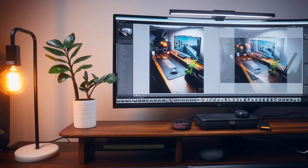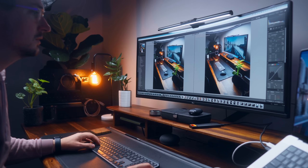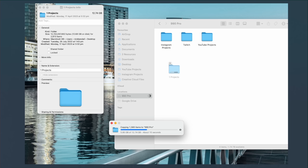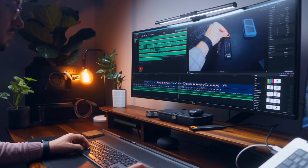Will you really notice a big difference jumping from an SSD to an NVMe drive? It really comes down to what you're using it for. If you're transferring huge files frequently to and from a fast internal drive, an NVMe enclosure will save you a lot of time. For editing, I've moved all my projects to this drive and it does feel a little faster. On my SSD there was occasional slight lag, whereas on the NVMe I don't notice that at all. If you're editing big projects with 4K or even 8K footage, an NVMe drive makes sense because those huge files can be read and written so much faster.